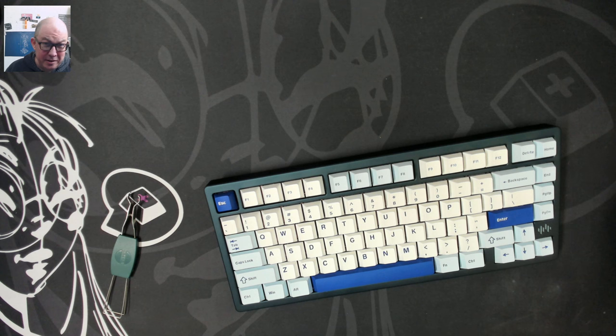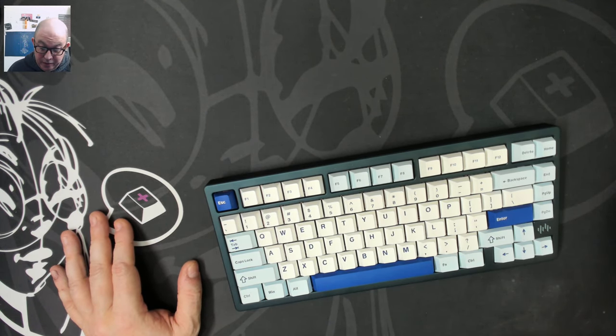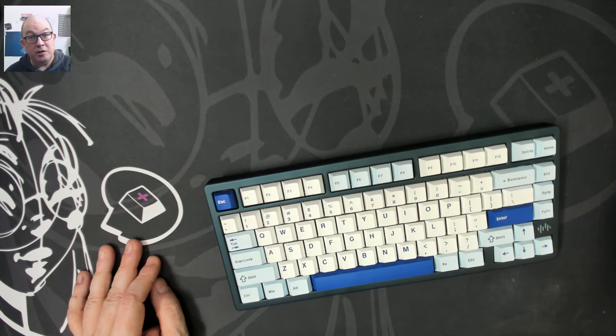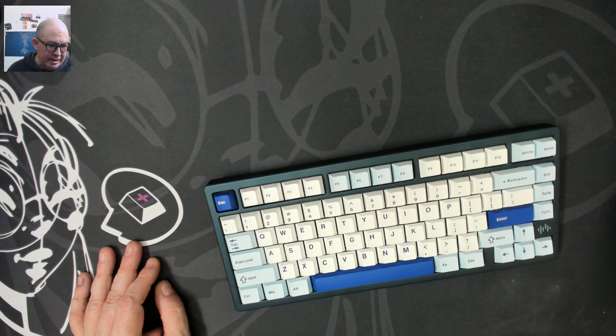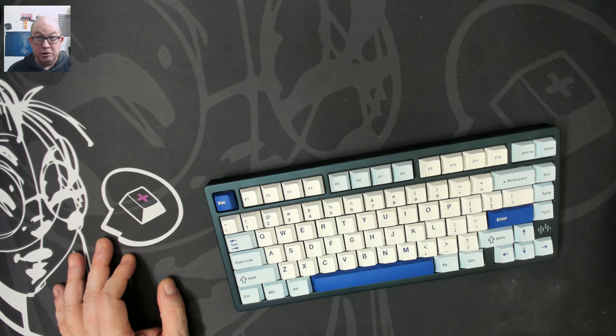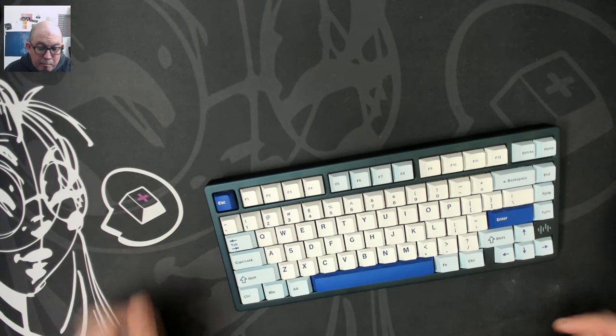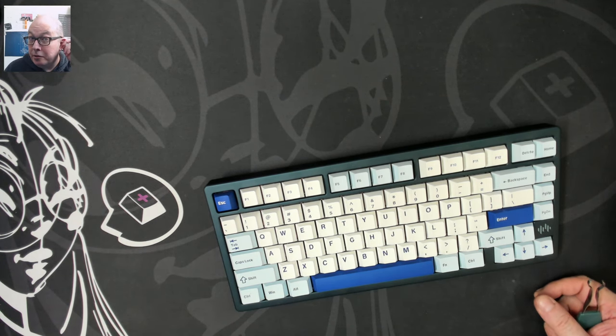All right, now that I'm fully covered in cat hair, not to make the story any longer, but basically, he flipped out when I pulled out the switch from a stabilizer key. I just wanted to see how the stabilizers were holding up, because they're not very good stabilizers, at least the tolerances weren't. It was one of the first dozen or so that I used the plumber's mod on, where you take the Teflon tape, or the plumber's tape, and wrap it around the wires. It was still on there, still good, there was no ticking, but I just wanted to see if it held up or if it slipped down, but it hadn't.